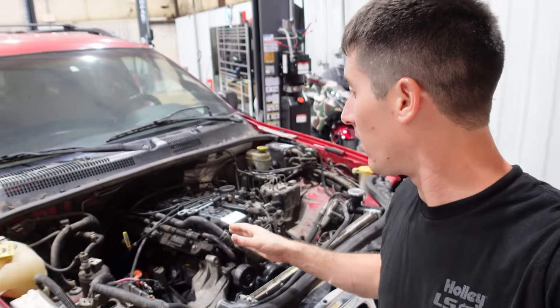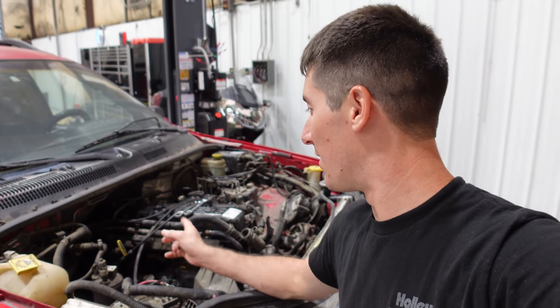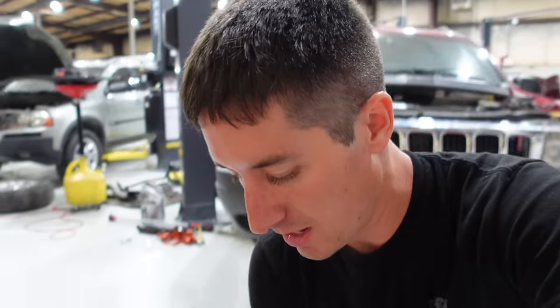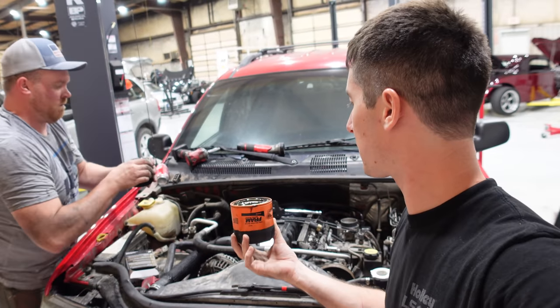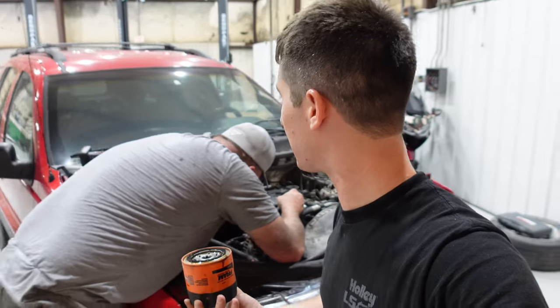New spark plugs in, coil packs on. Tyler was telling me that this coil pack is becoming unobtainium — apparently Mopar discontinued the six-plug coil pack that came on these things, and the Mopar one is the reliable one. Luckily I have two original ones. All new plugs are in, everything's connected on this side of the engine. This engine — I don't know if maybe this was a later year — it has a three-wire oil pressure sender and this one has a one-wire, so I ran over to the old engine, grabbed it, swapped it over, and we're back in business. We threw the fan shroud back on, installed the new filter, and what's left is O2 sensors, battery — I think that's basically it.